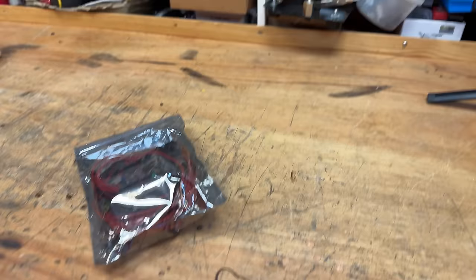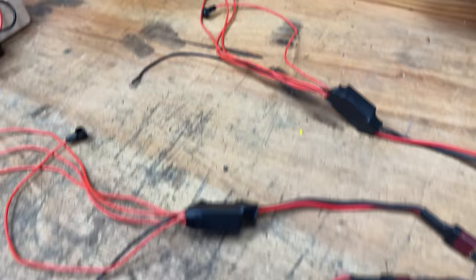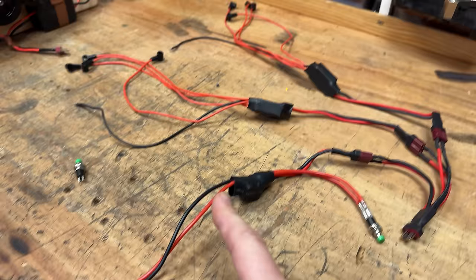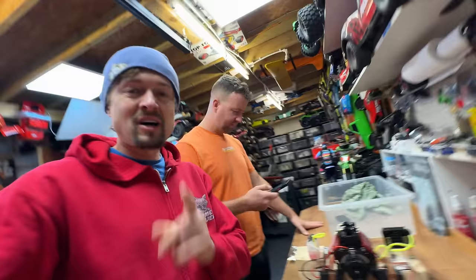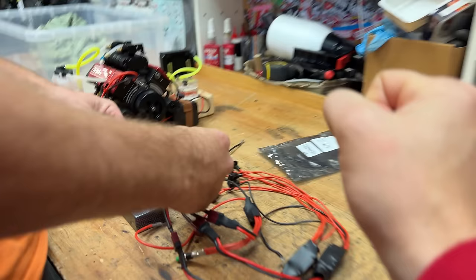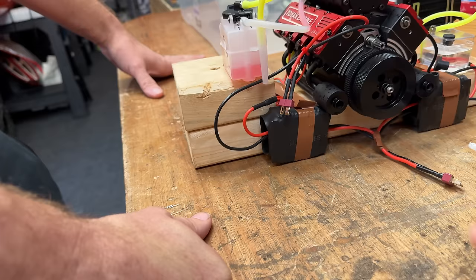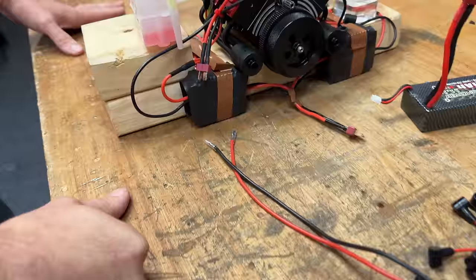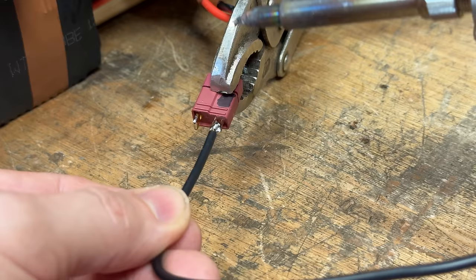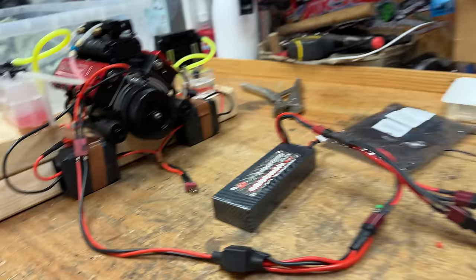So it's been a few weeks and we've got a new ignition system. Here is the new wiring harness - this one does the eight glow plugs, the starter motor, and we've got a start button. So in theory, all we've got to do is plug in the battery, hit the button, and it's going to run. Trouble is, we don't know what voltage it wants. On the Engine DIY website it says two to three S lipos, so we've got a three S lipo. We've got one problem where we're going to have to solder the starter motor connector on. We just wired up all the glow leads onto the engine - all wired up, that side and that side.